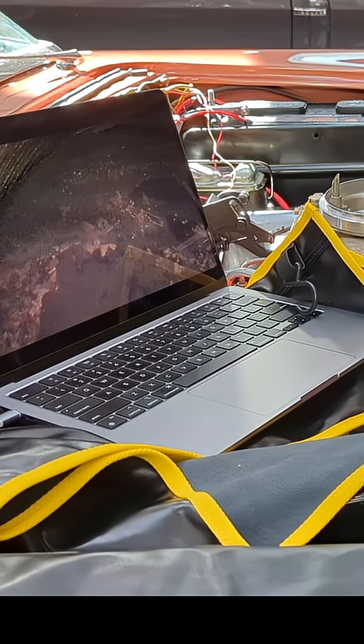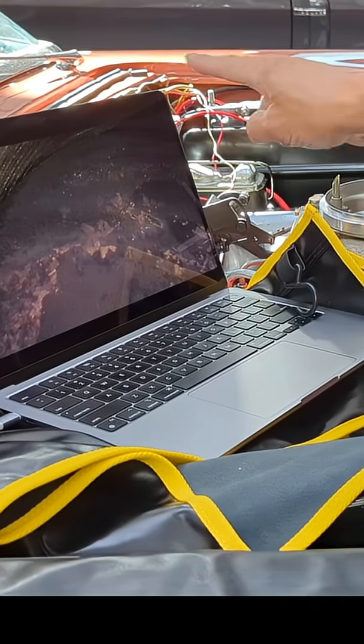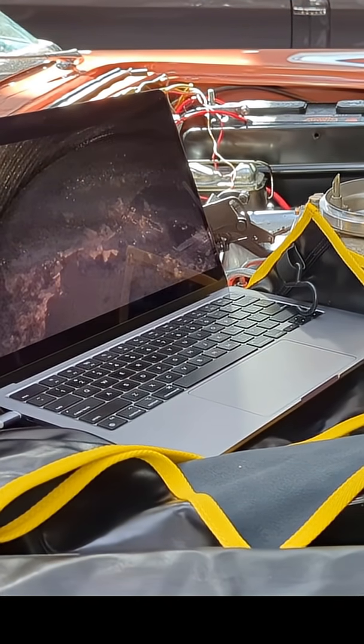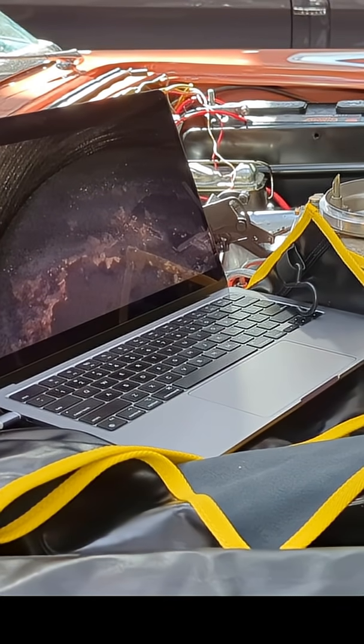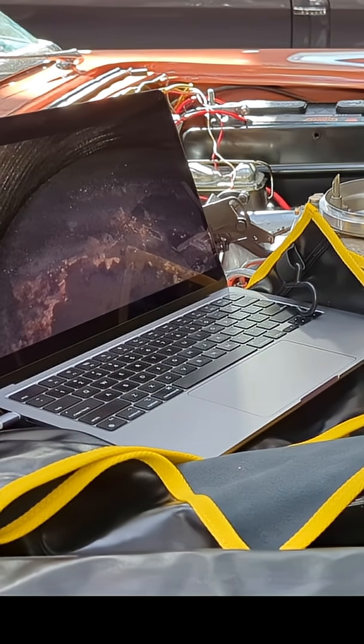Hopefully you can see on the screen — that is the top of my piston and the cylinder wall there. Watch what happens when I turn the crank. You can see the piston going down. It's tough to do while talking and pointing out all the video stuff, but the piston will go down and I'm going to wait till it comes back up. When it hits the top, I know I've gone to top dead center — kind of a modern way of getting there.